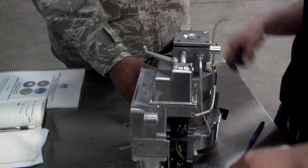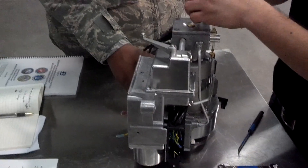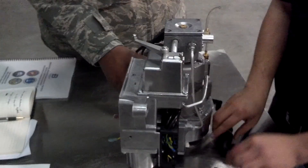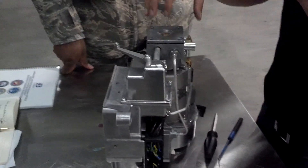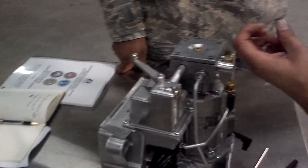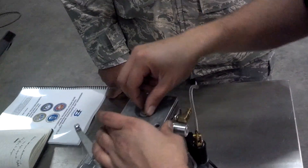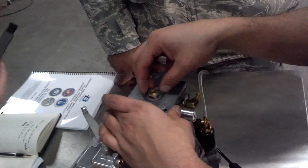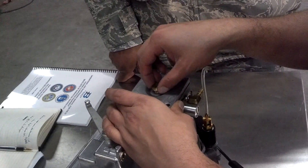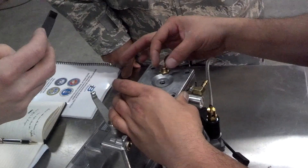So you take the four screws out. Now when you take these out, you want to make sure that the fuel pump base, when you open it, there's a spring under there. You want to make sure that you don't lose it. You can either take the whole base out and make sure that the spring doesn't fall out, or you can back this plug out right here, which you could do before you take the four screws out if you wanted to. I usually go just like this, and then make sure I keep that in its seat so I don't lose it.